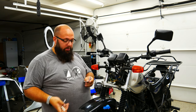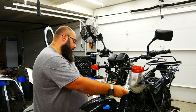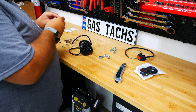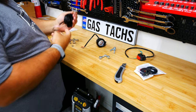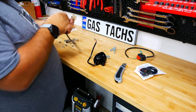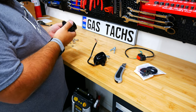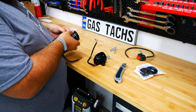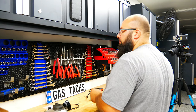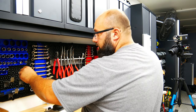Here are the actual ditch lights. The brackets are made to go right here — that looks pretty straightforward, so let's go and install these. The lights I got came with these brackets and mounts. One thing to remember if you're OCD like me: see which way the wire bends already. This wire is already bending this way so we're gonna use this for the left side, and if you want the nuts on the inside, make sure you input the mounting bolt first. I assume this is metric — it is from China.